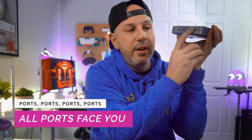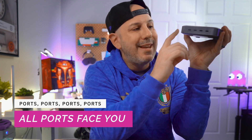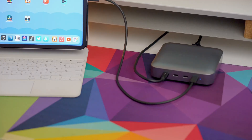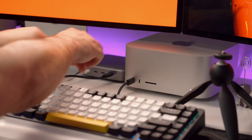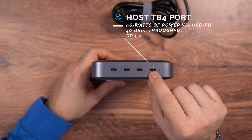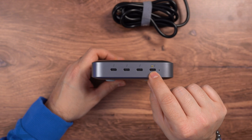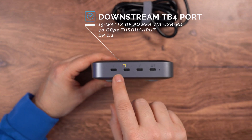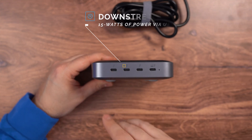In terms of ports, there are four ports along here — they're all south facing, which means they face you. Depending on your setup, this would work well with a MacBook Air or MacBook Pro because the host connection port is on the side of the device. If you have a Mac Studio or Mac Mini, it might not be the best setup because most of those host ports are located along the back, so you'd have cables traversing your desktop setup. The upstream port on the far right-hand side can deliver 96 watts of power to the host machine and transfer data at 40 Gbps. There are three downstream ports — each delivering 15 watts of power to an accessory like an NVMe drive, an IO drive, some type of RAID controller, or even an external display. They also support 40 Gbps of throughput, and that's all shared.